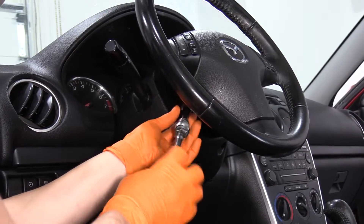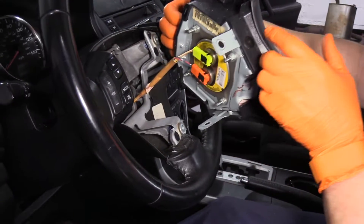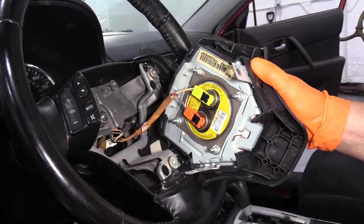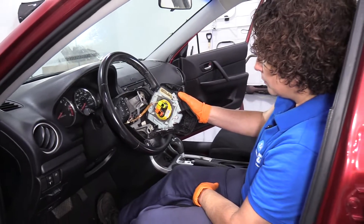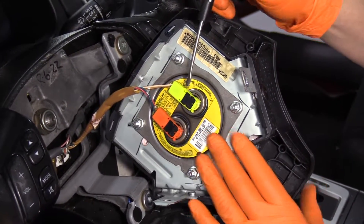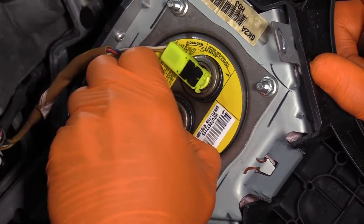You'll see the cover with the same marking as the right side. Now with the two mounting bolts removed, grab the airbag module and just lift it out. Quick reminder before disconnecting the airbag module: make sure your negative cable has been disconnected from the battery for a minimum of 10 minutes. Then you can disconnect. To remove the two connectors on the driver's side steering wheel airbag module, these black plastic things are a safety clip — just pry it up, then push on the front tab and lift it out.